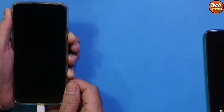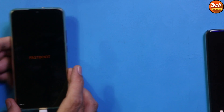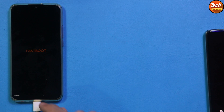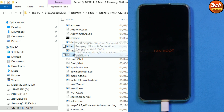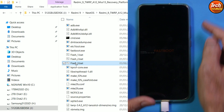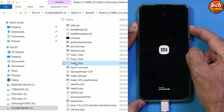In a few seconds you will see the fastboot screen, then release the Volume Down key. We got the fastboot screen — the mobile phone is in fastboot mode and connected to the computer. On the computer, go to the extracted custom recovery folder and double-click the 'flash_1' batch file. The recovery will start flashing. When finished, double-click 'flash_2', then double-click 'flash_3'. Then immediately press and hold the Volume Up key before the Mi logo appears so the phone boots into TWRP recovery.